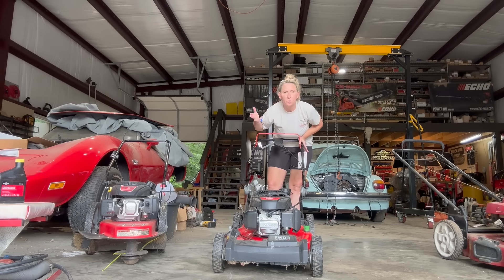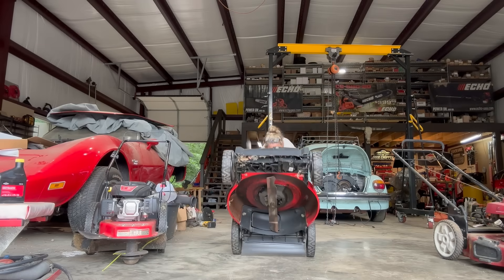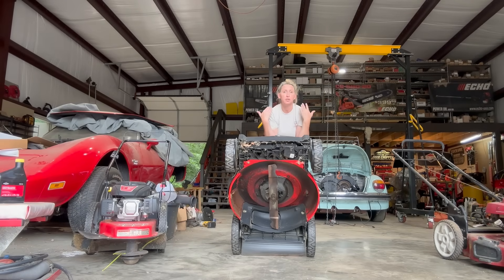The best way to look underneath your mower is by pushing the mower back. Same thing with a pressure washer — if you need to turn it on its side for some reason, definitely always go backwards with it. If you had your machine turned towards the carburetor side, it leaks oil into the carburetor, and you've got to have your carburetor cleaned out. If you have it turned towards the muffler side, it's not that big of a deal because although it might leak a little bit of oil into your exhaust, it should burn out the first time you run it.